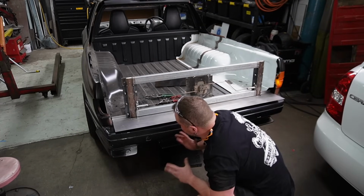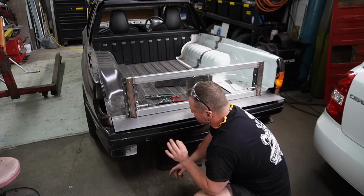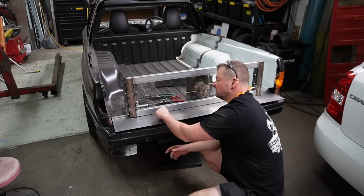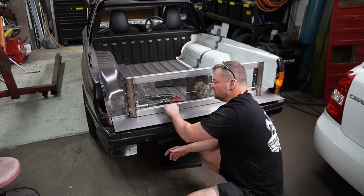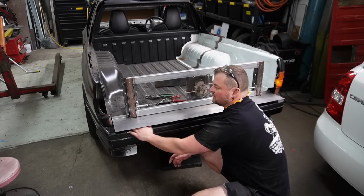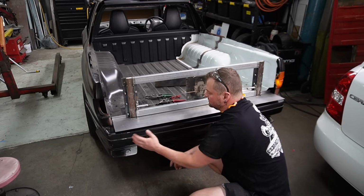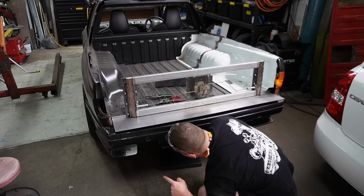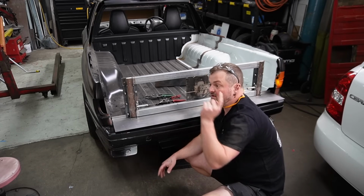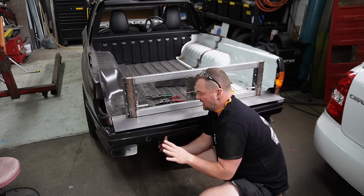So we are sitting up on the outer part of the hinge, which I need to think about whether or not we want to cut around and clear that hinge, or if I put just a little fold in this panel down and then flatten off again. So then we've still got that right point, because we've got about a 10mm gap between the chassis line and this panel. Really difficult to show you because it's like right in there. I think what I'm going to do is see if this is short enough to fit in their folder next door, or their brake, because if it does fit in there, I can just bend it up and it's done.